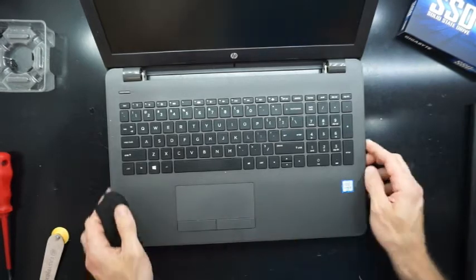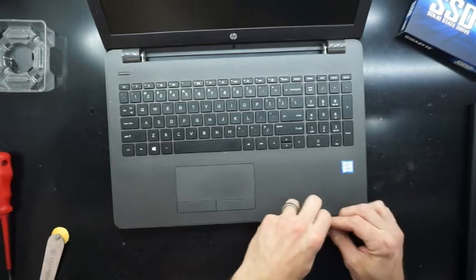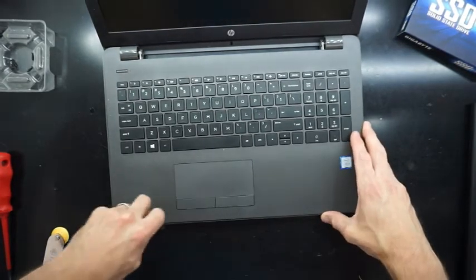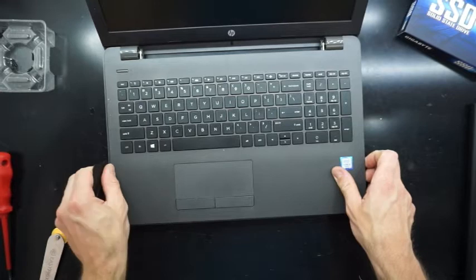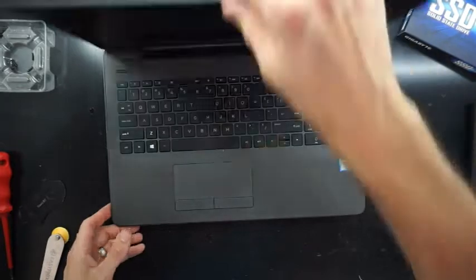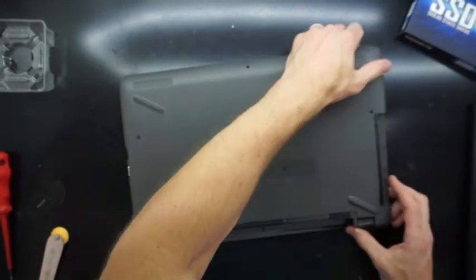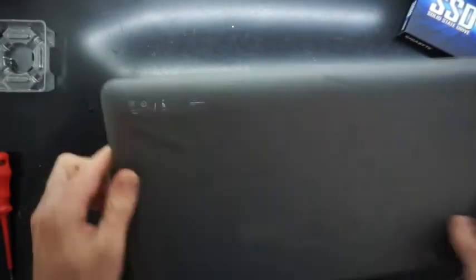Being it's soft plastic, you should be able to push it between the bottom cover and the top cover without damaging any of the plastic. It does take a little bit to get it there. This is the side that's got the ports on it — that's a bit more of a challenge, so we just have to be a bit more careful. From there you should be able to open it up from the DVD side. You do have to kind of twist it downwards as you open it, pulling it towards you as you lift it up.